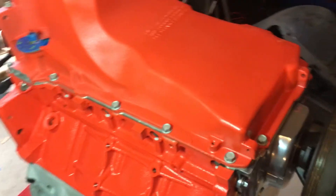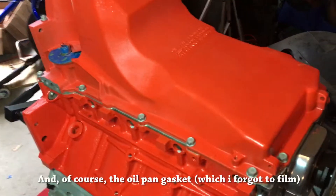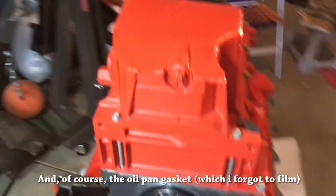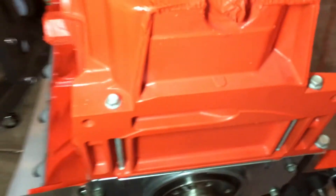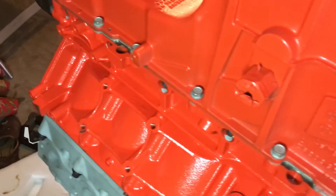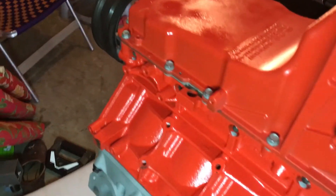A little bit of time has gone by — I had dinner. Without a whole lot of effort, I was able to get the oil pan on and torque it down. It's on spec: 18 foot-pounds for all those guys and then 106 inch-pounds for the two dudes in the front. There's a bolt pattern for that — start at the center and work your way out. Check with the manual. And that's it. We'll see you next time.